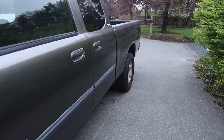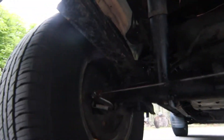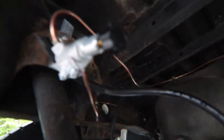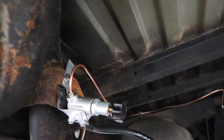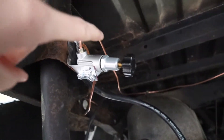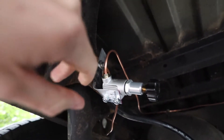I'll show you here what I did. In the back where the original valve sat, I just unbolted it — it bolts up to the shock tower in the rear. I made a little bracket and installed the Wilwood valve on it. I ran new lines too because the old lines were just completely destroyed.